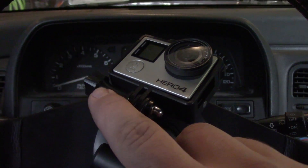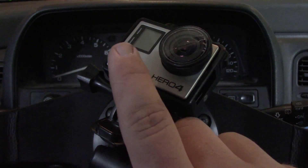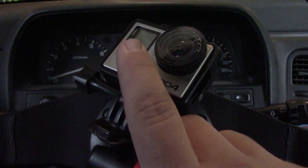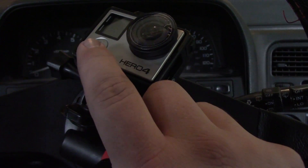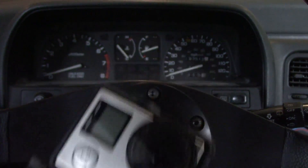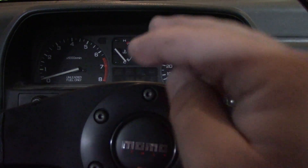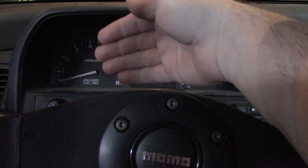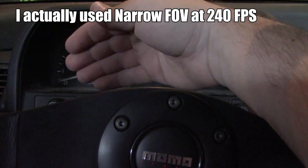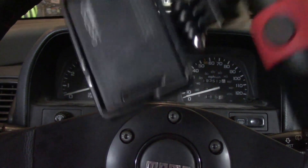The higher the frame rate of your camera, the better. Most phones record at 60 FPS these days, some at 120, but you'll want the highest setting possible. This GoPro normally records in a wide-angle format, but I'm setting it to linear mode — available on GoPro Hero 4 and up. Wide-angle distorts the tachometer on the edges and messes with results, while linear keeps the numbers in a readable format as you go through the footage.